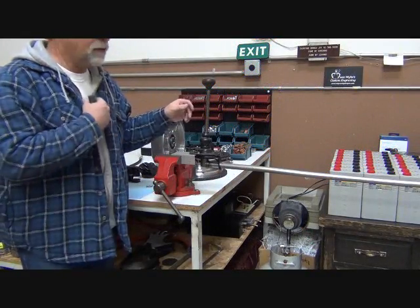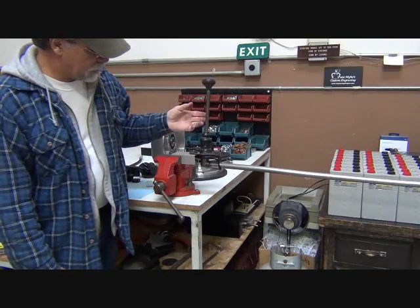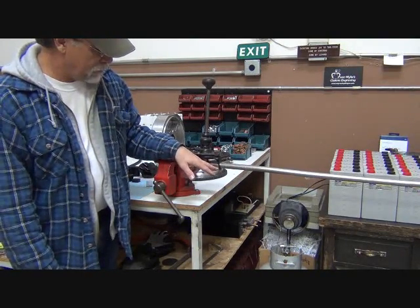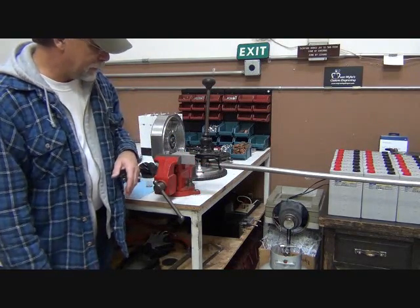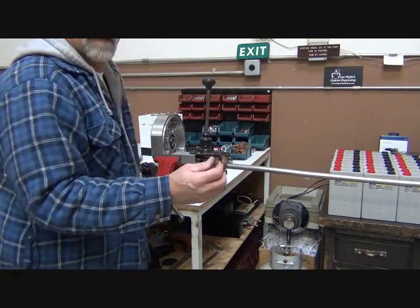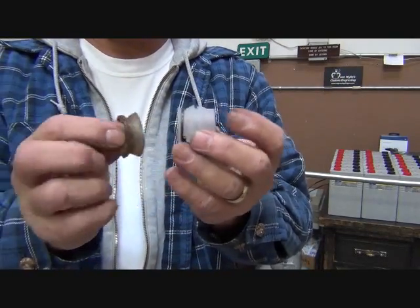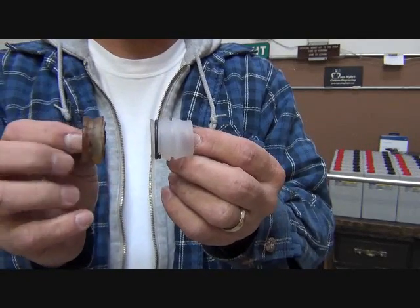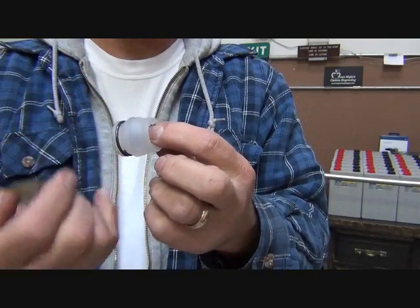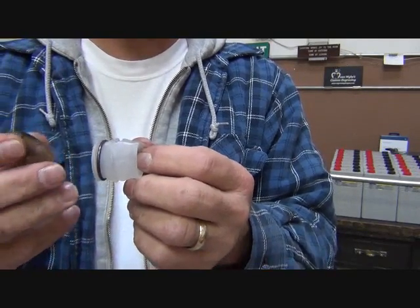Okay, I'm going to be headless in this one, but I want to show you the setup here. This is the stick shift with the shift rod without the bushing. As you saw when we looked at it in the vehicle, the bushing had been cut in two, which is very common. Here it is. So this is kind of what was left of it right here. And that's commonly what happens: right here is the point where it goes into the hanger, and from that rod running back and forth, it just cuts in half.